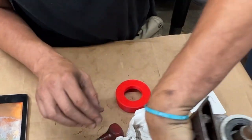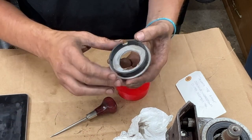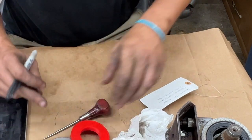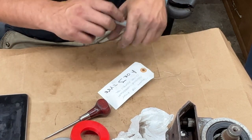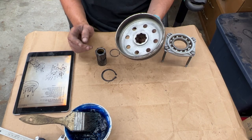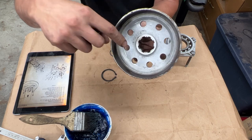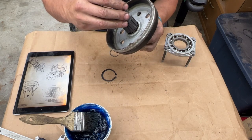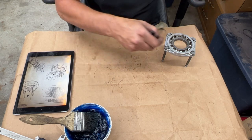You can print your own tool or make one — I just took a piece of pipe with a 2.5-inch inner diameter and glued it to another piece of plastic. Or you can try a rubber band, though I haven't tried that myself. This A/J-type tool works for both. Now we're going to grab our next part: the hub of the cone clutch. We have a little issue — some dented corners here where the sun gear didn't fit nicely, so I need to file them a little bit.